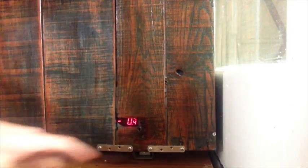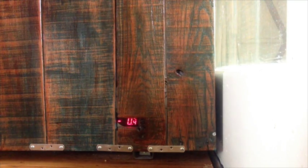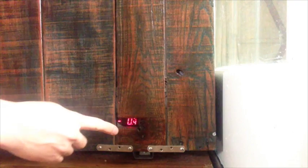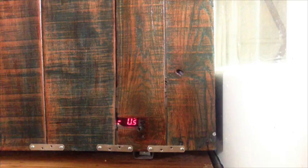That's a bad idea. If you see this little number right here, that's the temperature in Celsius — what the temperature is inside. It's designed to be a freezer, so if you leave it as a freezer, it's going to freeze your beer. This helps prevent that from happening. This is the installed one — it took me using a Dremel to cut through the face on the bottom there and install that display, then I wired it in. If you don't want to do all that, there is a plug-in variety for about 40 to 60 bucks on eBay.